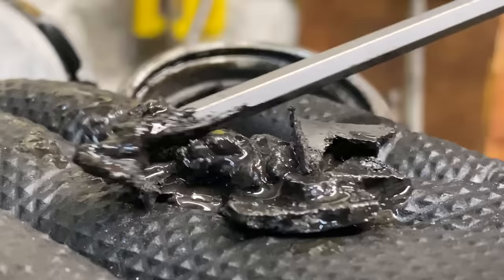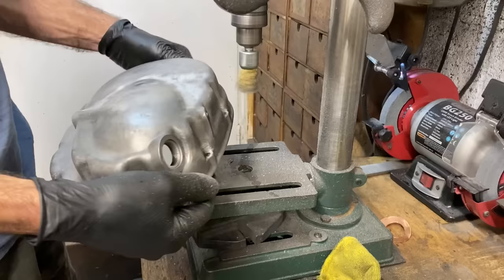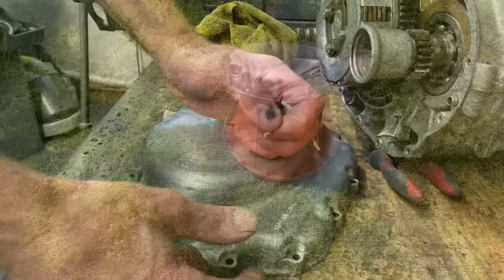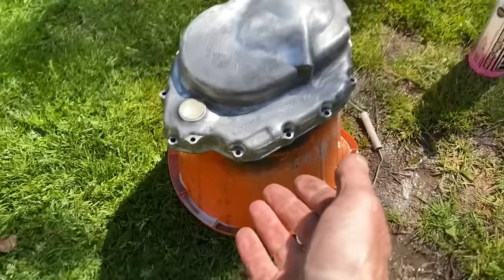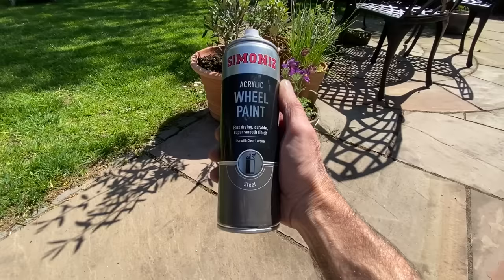After cleaning out the oil filter I decided to clean up the clutch cover and give it a quick coat of paint to make it look a bit nicer. These casings are made out of magnesium and will rapidly corrode in salty conditions, so they really need to be painted. Using some abrasive cloth I give it a good rub up to make a nice key for the paint. I mask the kickstart oil seal with masking tape, then spray it with bike cleaner followed by a hose off with water. I take it over to my barbecue to dry and warm it up a little bit because the paint just sticks better and hardens quicker. I use this silver wheel paint — it has a built-in undercoat and can be sprayed directly onto the surface.